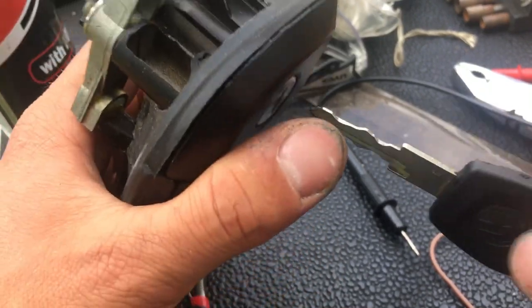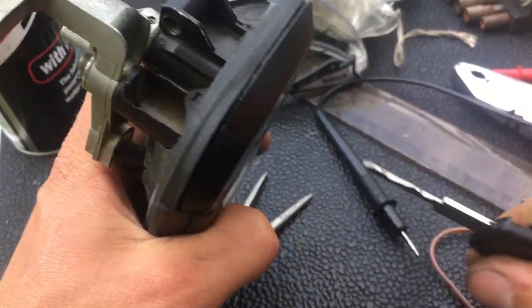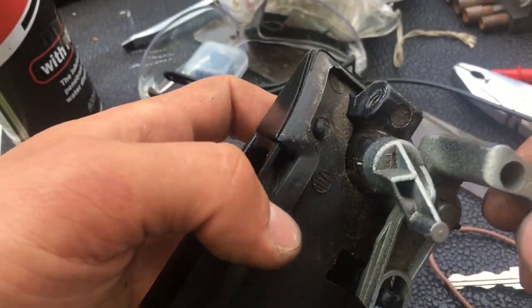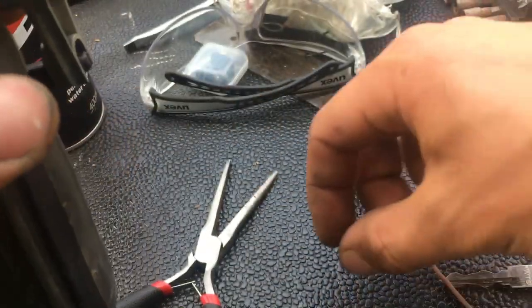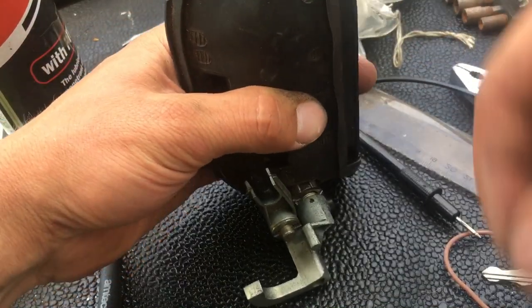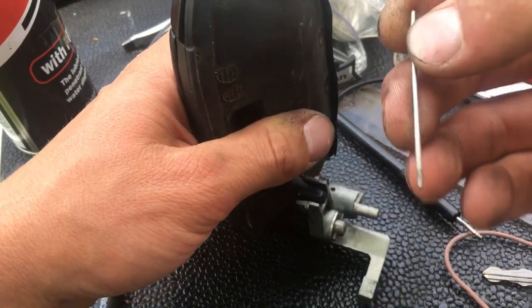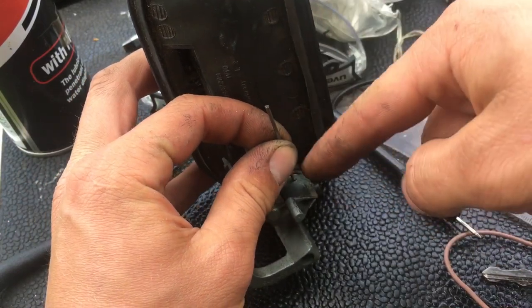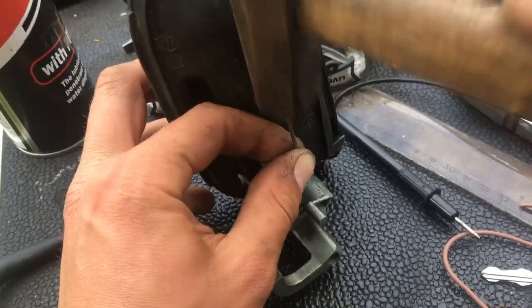So this key does fit in but it doesn't twist, as you can see. We need it matched. The cylinder locking barrel is this small unit here, and it's held in place by this pin. To get the pin out, position the handle like this, then use a small pin — a nail works too — but make sure it's not any thicker than the pin already in the cylinder, so it doesn't damage the hole. I'm just going to use a hammer gently to get the pin out.